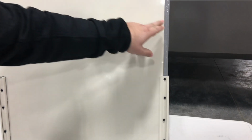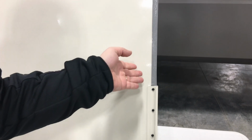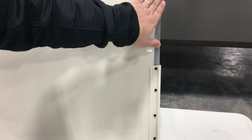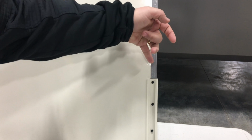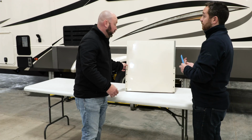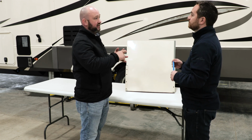And so with the mylar, you have a plastic backing. Let's say your caulk cracks, you don't see it happen, and water gets behind it. The water will get back to the mylar. The mylar has a plastic backing going and wrapping your walls, and water can't get into your walls. And the idea is that the water will come and ooze out of the bottom. And with the butyl, if the caulk cracks, you're just asking for water to get in behind your wall, causing a delamination. And we're still just talking about the rear wall rail, but remember, that's windows, that's everything.